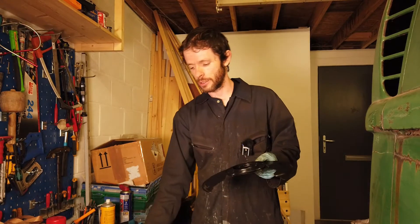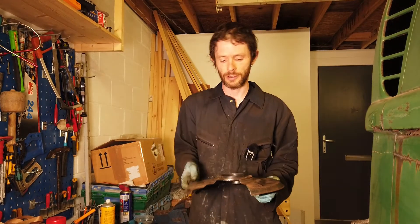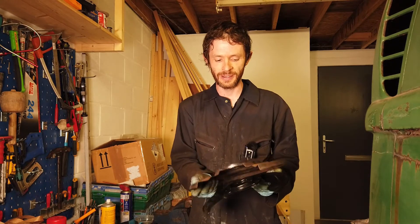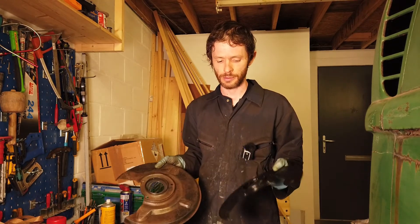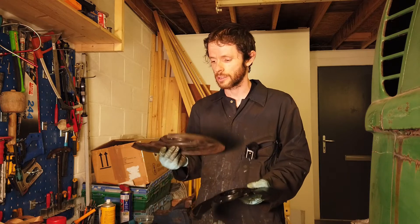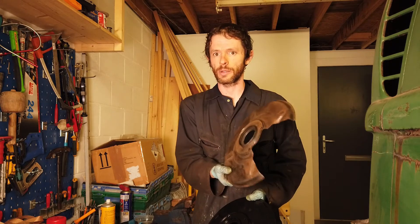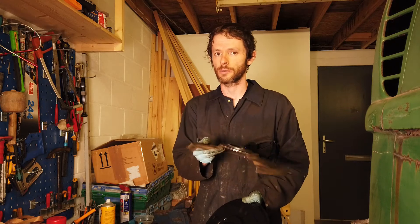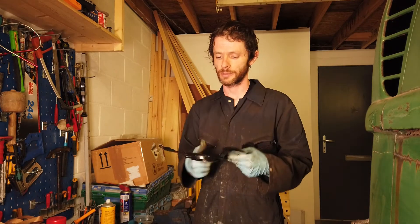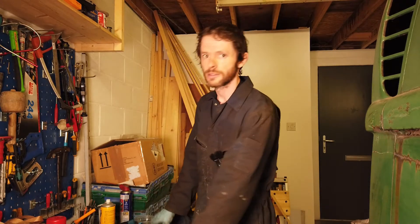When you compare it to the old one, the old one seems much bigger and much stronger, and the holes are all in the right place. Don't buy these new ones - they're just not great. If you can avoid messing around drilling holes in them, it's best avoided. If your backing plates aren't great, just restore them. These ones are off the green van. If you can find a secondhand set of backing plates somewhere, that would be another option.